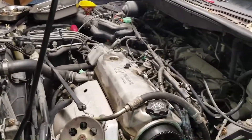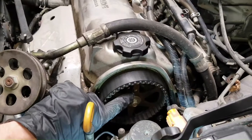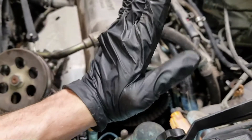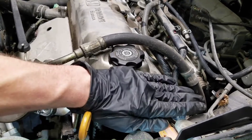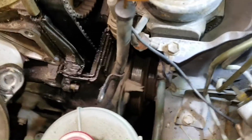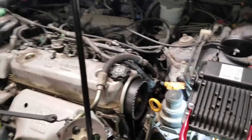I confirmed that the timing is right - that is awesome. I was really worried about the timing being off because there was probably about three quarters of an inch of slack in the timing belt, and there definitely should not be that much. This mark here says 'up' so that's got to be straight up relative to the engine, and then there are two notches on either side that have to be lined up with the top flat plane of the head.